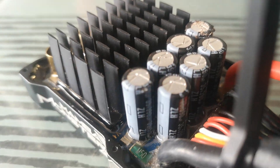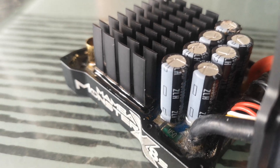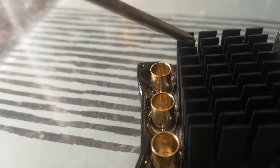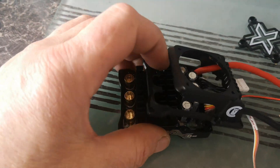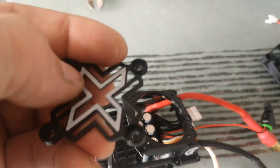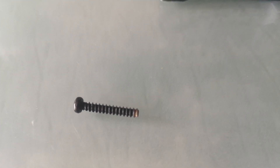Right, I don't know if you can quite see it — just this little mark just here. The screws are coming through too far, and it's also visible on top of the heatsink. I've done a measurement from the top of the cap to the outside recess, and I worked it out to be 13.5 millimeters. Castle are using 16 millimeter screws, and you can actually see on this screw the marks from where it's broke through that capacitor.